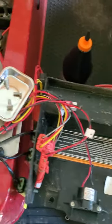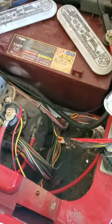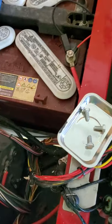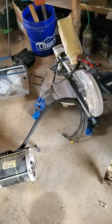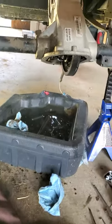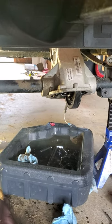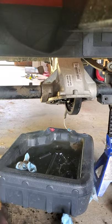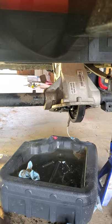For tow mode, take these push pins out, flip the panel up and lay it out of the way to get to your three bolts. Undo that, and the wiring harness runs right here to the motor — and there it is, removed.